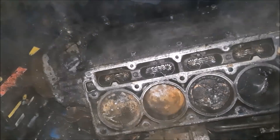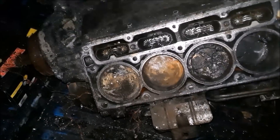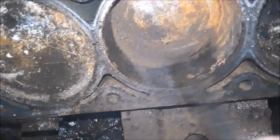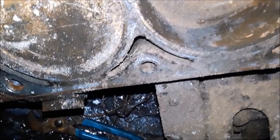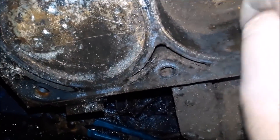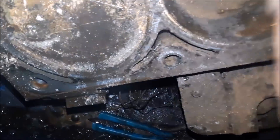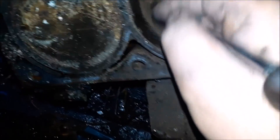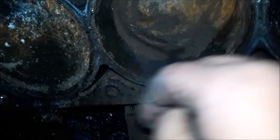Got the heads off of this thing and definitely what I suspected — rusting in the cylinders. I got a couple of them that look pretty good, it's gunky. Got that one there which has got some intake material in it that melted. I don't see any serious pitting though — like everything is scraping off. I'm really hoping I can get this cleaned up and honed. First I got to get it freed up, put some PB Blaster in there and let it soak overnight. Suck all this garbage out of here. I think we'll be fine.